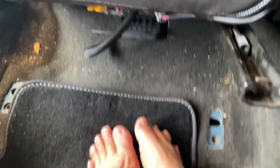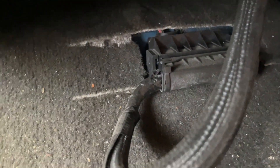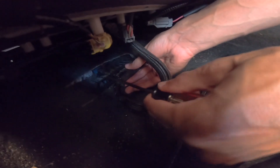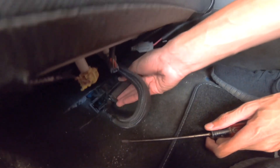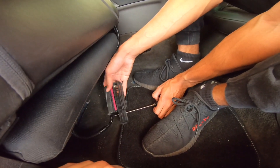When you start lifting and pulling forward, the hooks will come out immediately. You'll have this master connector here that you'll have to unplug, and once you unplug that everything else will come sliding off. To take the master connector out, get a screwdriver and slide it aside — there's a little section where you can slide it out, like a lock. But don't slide it out all the way because if you do it'll never work again, especially with these seats.